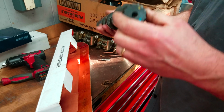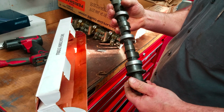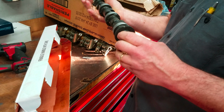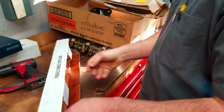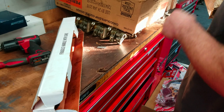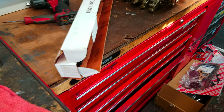So the black coating is called parkerizing. Okay. It's almost like an engineered rust, really, and it just helps preserve it while it's not in oil. It also creates a textured surface to aid in break-in. Oh, okay. Not a spec in it. No? Alright, I saw a picture somewhere with, I believe, the specs to that. I'll try and text you that later.